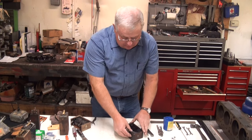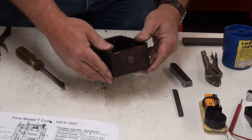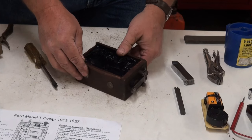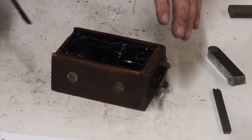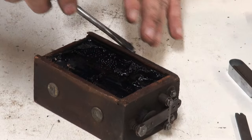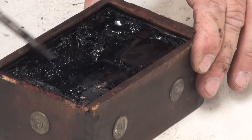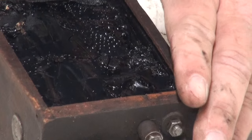If the side doesn't come off the coil like we did on the last coil, we've got one here that has really nice and tight joints. We don't have any movement on it. So we don't want to break those loose because you'll probably damage those finger joints. So we're going to have to remove that tar, and again, remembering our anatomy of the coil, knowing that the capacitor's going to be up against this wall,